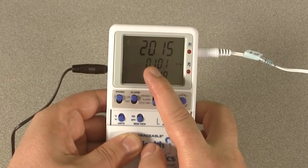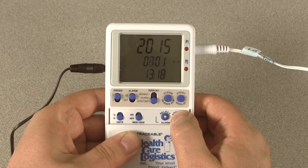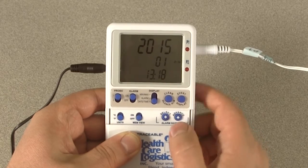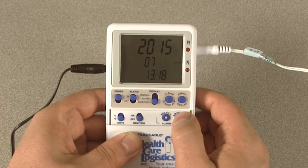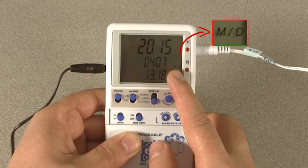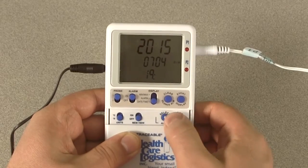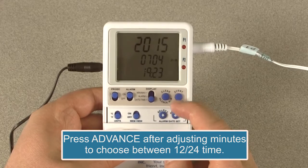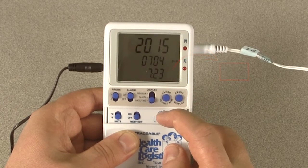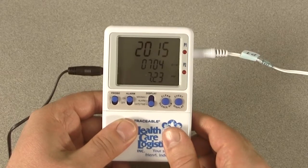Press the select button again and the day will flash. Pressing and releasing the advance button will increase the value one day at a time; holding down the button will increment through the days automatically. After day 31, the device will roll back to day one. Pressing select a third time will adjust the month. Pay attention to the format the thermometer is displaying the day and month — just to the right it will tell you the order. You can change the position of the values by pressing the event display button. Pressing select a fifth time adjusts the hour and a sixth time adjusts the minutes. A final push allows you to select between 12 and 24-hour time. If the thermometer is in standard 12-hour time, you will see PM next to the time. When done, either wait 15 seconds without pressing any buttons or change the position of the display switch to save your changes.